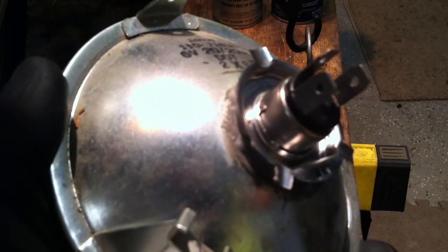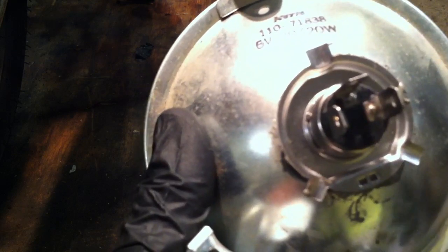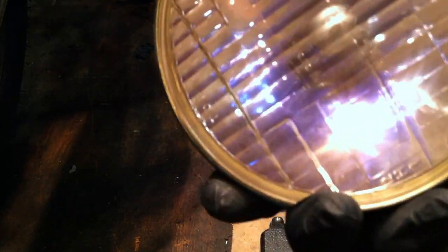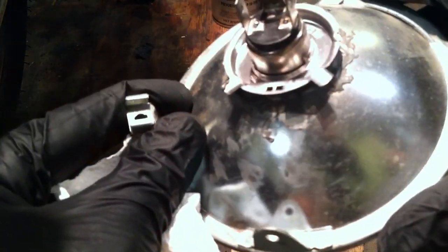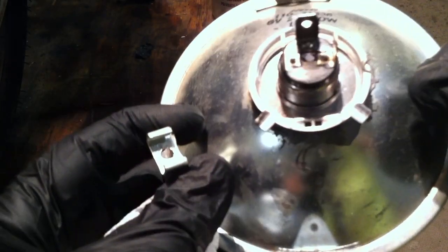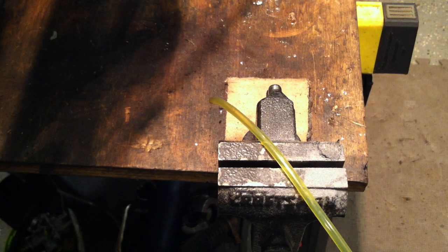You don't even have to order a two-pack — you can get them in single packs. The stock headlight is 6-volt 20/20, and this is 6-volt 35/35, so you're getting a more powerful headlight and not paying $40 or $50 for an OEM stock headlight. The deal with the stock bulb is it's a sealed bulb — if it burns out, you can't just replace the bulb, you have to replace the whole headlight. This way you can just replace the bulb. With a little JB Weld, you're looking at maybe $10 total. We're just on tip four.